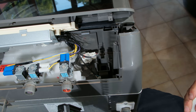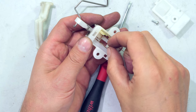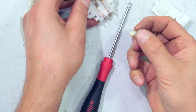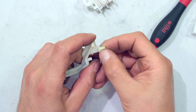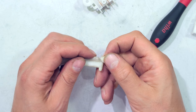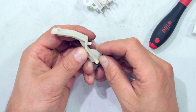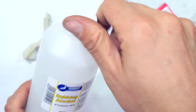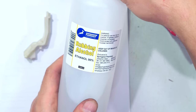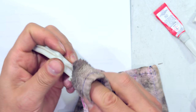I'm opening the switch unit to inspect it. You can see there's a piece of plastic deposited inside — yes, it's a perfect fit from the broken piece. I'm going to repair this using a combination of super glue and plastic welding, and then extend the lever back to normal length. The first step is to clean the surfaces with alcohol — not sanitizer, pure alcohol with no glycol — so there's no oil before gluing.